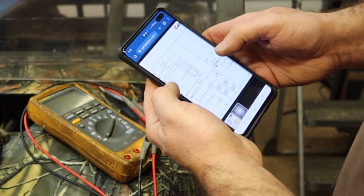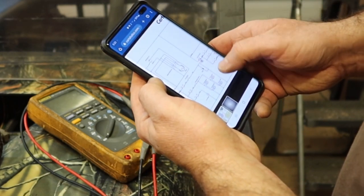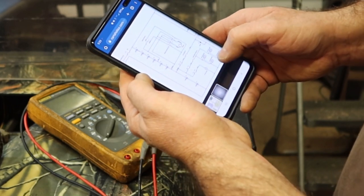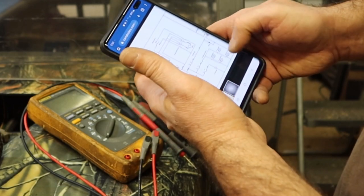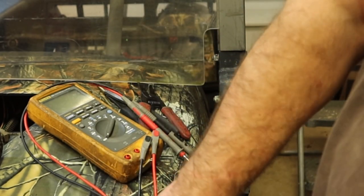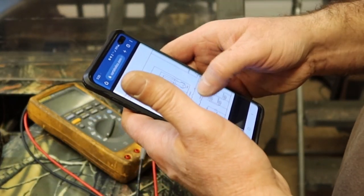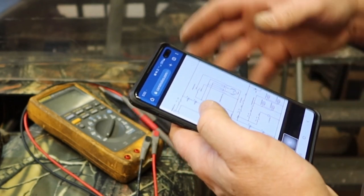So I'd like to see if going straight from that charger plug potentially has the same effect. And I'm also noticing that the ground to the headlights is in the exact same place. So I want to see if I can find something that this headlight is actually connected to that'll give me a closer ground that's a substantial size that can handle that much current.